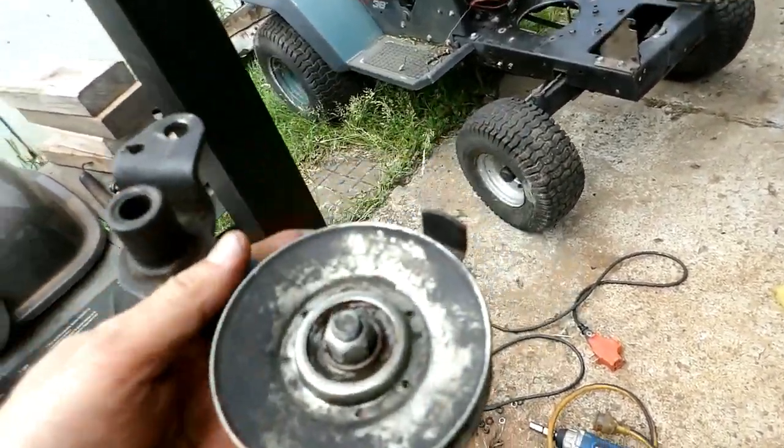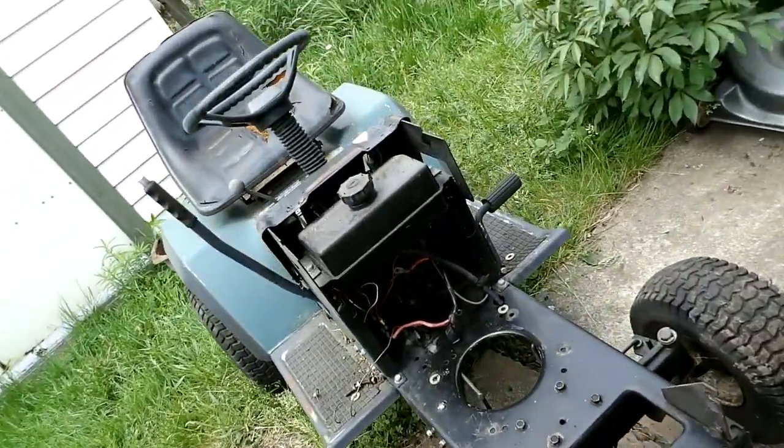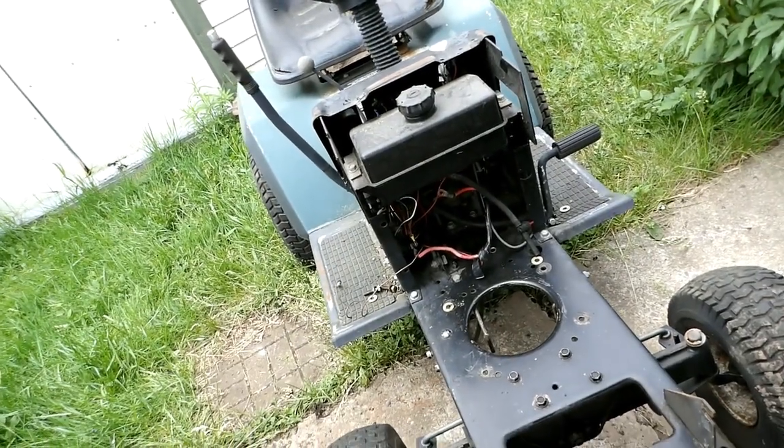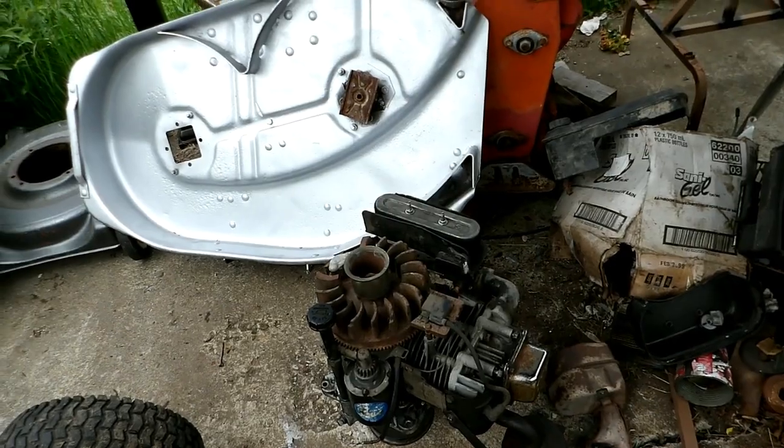Here's the drive tensioner and it's a little loose also, but I pried both seals out of it and put grease in there. There wasn't much grease in it, and what was there was dry like wax. The intention is to take my 12 and a half horse engine and put it on this deck.